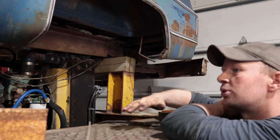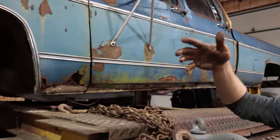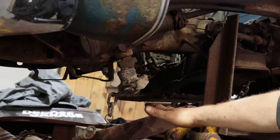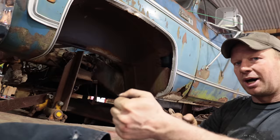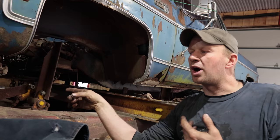To be able to move it up and down with the four cylinder in the front, the frame rails are too narrow. Regardless, if we move this ahead, the steering box won't be in between our steering anymore. So it's two options. Might go to V&R and see if there's an old tractor there with hydraulic steering, because we can run the hydraulic pump through the steering, and then we can get rid of this box altogether and mount something solid to here on a cylinder that just goes back and forth. Problem with that is it becomes really strong, and we don't want to put too much tension on the brakes, because keeping in mind it was meant to be done manually by a person who hadn't eaten properly in months and was scared shitless when they're driving the tank. So to have a hydraulic cylinder doing it, we will probably burn the brake bands out prematurely.